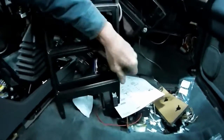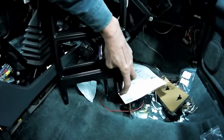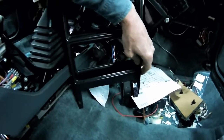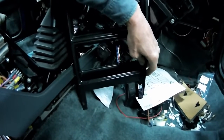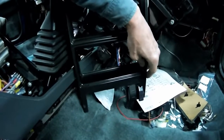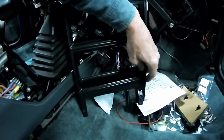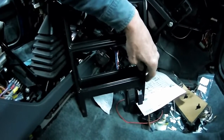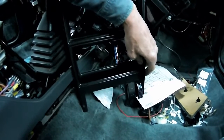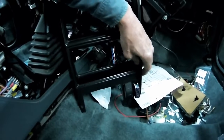I've got my dash all torn apart again. One of the things I'm doing — I actually did this years ago — is I've had a fuel leak issue internally where when you shut the key off the fuel pump shuts off and the fuel pressure will bleed back into the tank, and I have not been able to isolate it even putting one-way check valves in. So I'm kind of hesitant to do away with this even though I may have the problem fixed.